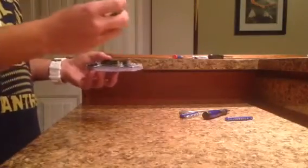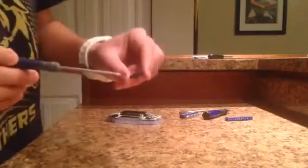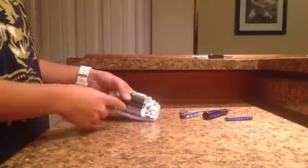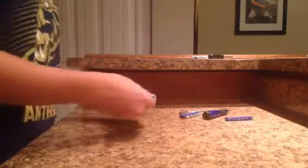So after that, you take this little plasticky piece that I didn't know what it was. It's actually the power switch. And there's going to be a little clip that looks like two teeth. Here, let me point with the screwdriver. There's two little teeth sticking off right there, that you want facing upwards towards the same direction this is facing. And then you kind of drop it back into place, and it should fit relatively easily. And again, you can slide it back and forth now. You're going to want to make sure it's towards the off direction.